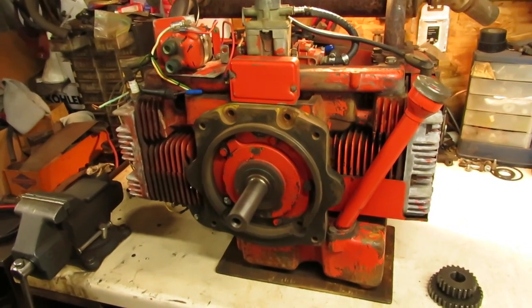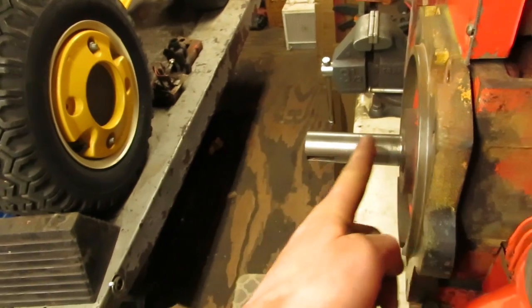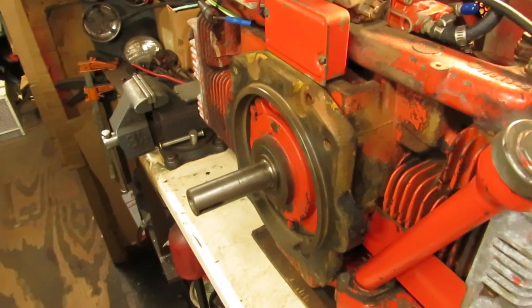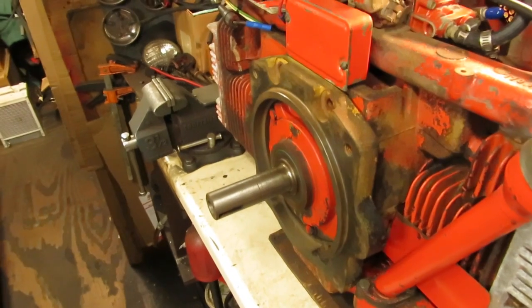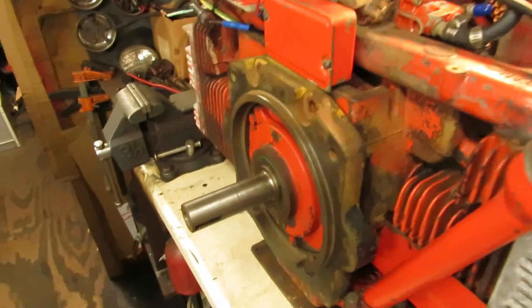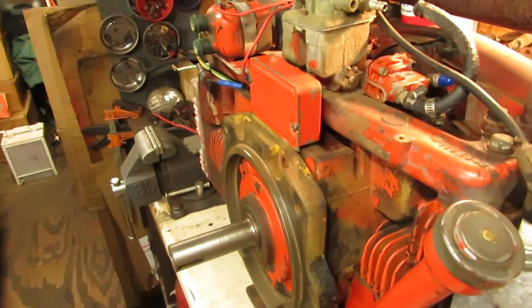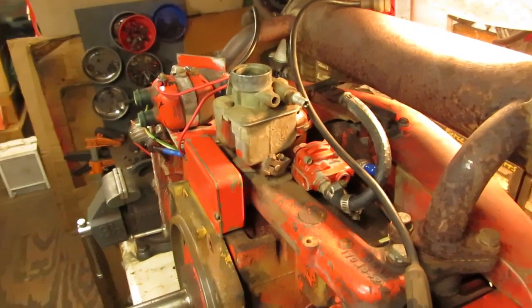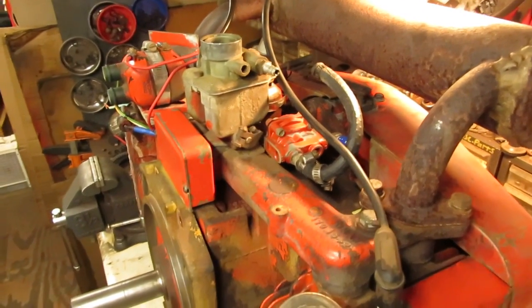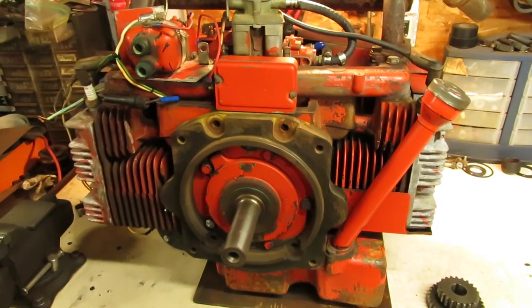I'm going to keep the videos in this series down to a reasonable watch time. The main focus was to make sure I could get this Onan running and that everything checks out — and since it has, I can keep going with the project. In the meantime I'm going to measure out the back of this crank in relation to where the gear has to sit when it gets machined. I'm also going to look around for about a week and make some calls to see if I can find somebody who has an Onan CCKA 450 crank from a Gravely, because I'd much rather swap in a 450 crank than have this good one turned down. Once that's squared away, I'm going to order all the gasket kits, a carburetor rebuild kit, and take care of the fuel pump. In the next video we can start pulling this apart and get this crank separated. Until next time, there you have it.